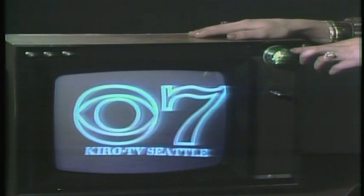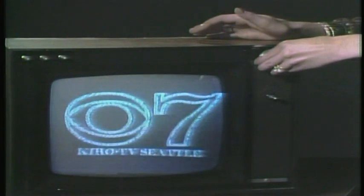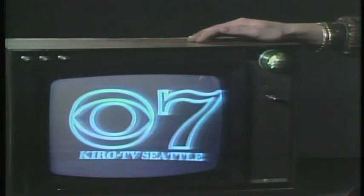Don't be afraid to use it. It's there for a good reason. In fact, let's try it together. First, turn the knob in one direction until you observe a distortion of the picture or until the picture breaks up simultaneously with the sound of the program. Then turn it until the picture clears up. That's all there is to it.